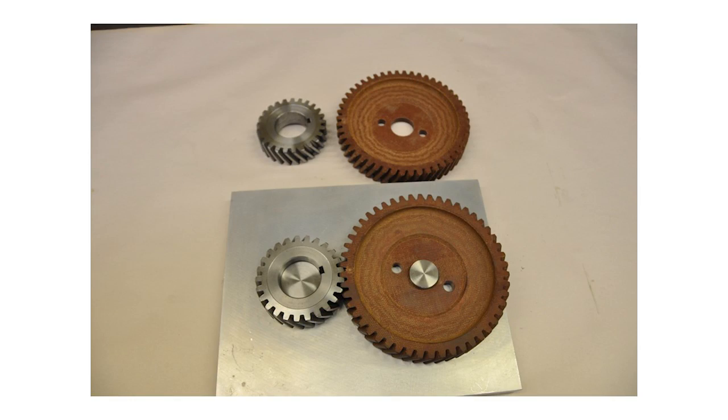Timing gears — we have our own timing gears now, developed from the Ford print. Yes, they are made overseas, but they are exactly right, made to the print. We have a gauge at the back of the room if anybody wants to inspect it. The gauge calls for the exact dimensions from center to center, and the gears are placed on it to measure that they have their two to three thousandths backlash when installed over the pins.